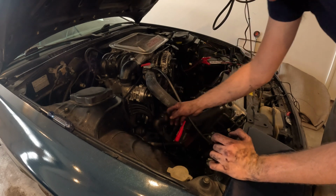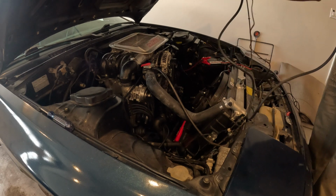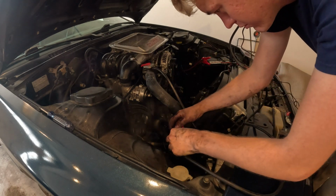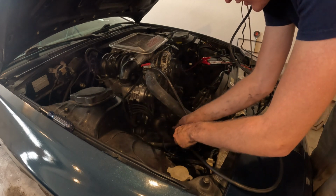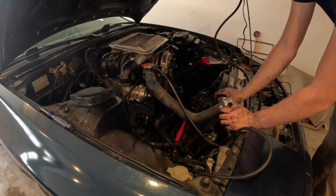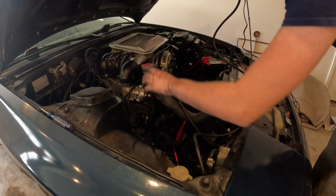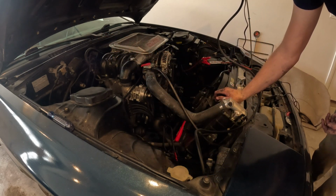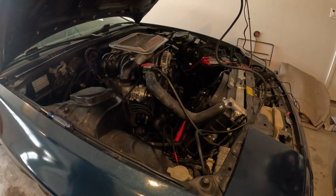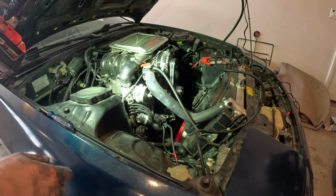and it is seeming pretty plugged, so I'll grab my hose from the smoke tester, start my fan from the integrated air compressor, and now that we've got smoke, plug it into the end of my plug, and we see where it comes out. If it's nowhere, I'm going to be shocked. We'll wait a second for it to come up to temp, so to speak. I'm sure it's got to fill all of this nonsense with smoke before it really does much. It's not bleeding back out of the intake, so we know our plug's doing its job. I'm going to grab a flashlight so we can see better too. By flashlight, I meant big old Milwaukee work light.